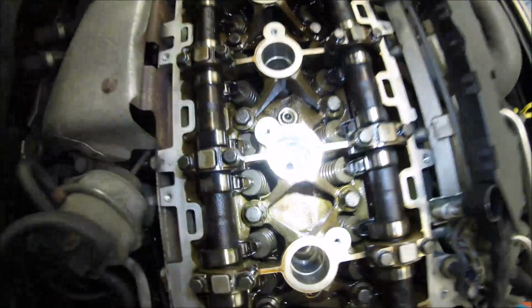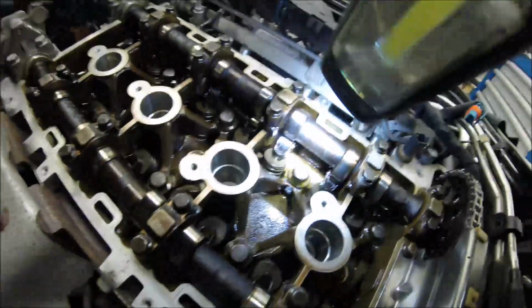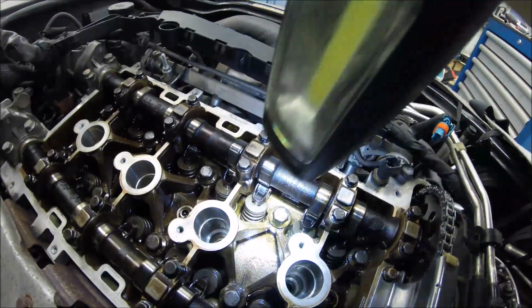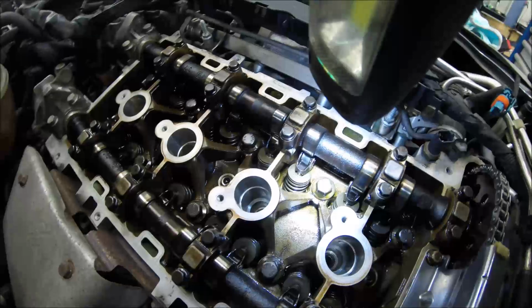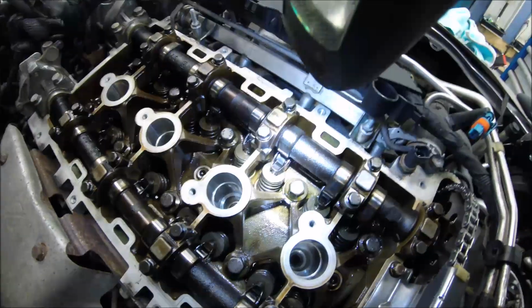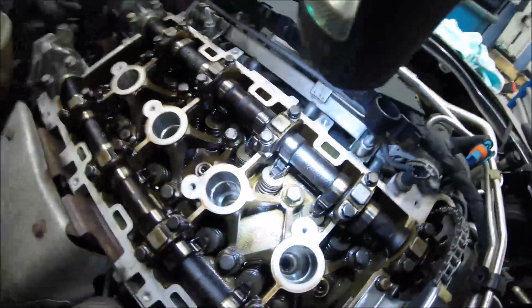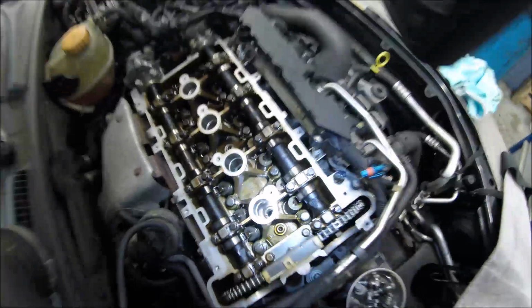Yeah, that's the problem. So the idea now is to remove the rockers from the cylinder, first one side, next the other side, and try to put something in the cylinder, block the valves and disconnect. I hope nobody tried to replace before with this, because if the seals are fine, probably something is cracked, like the head, but we'll see.